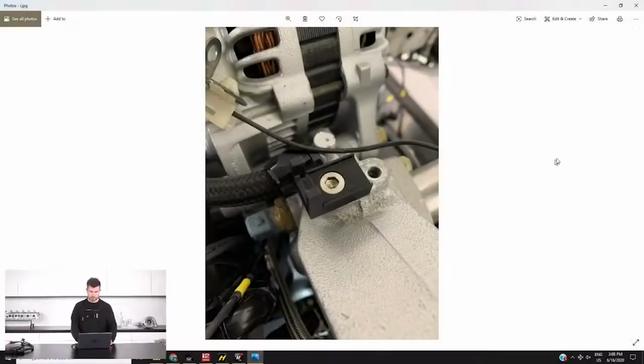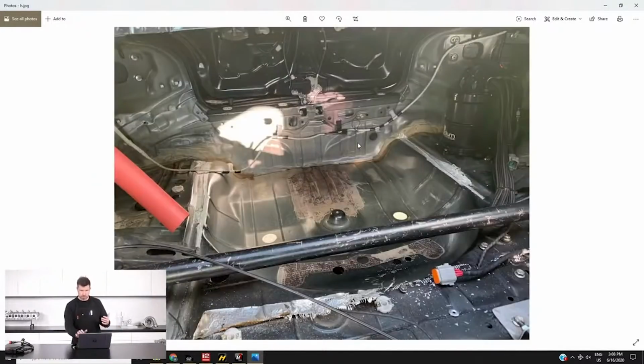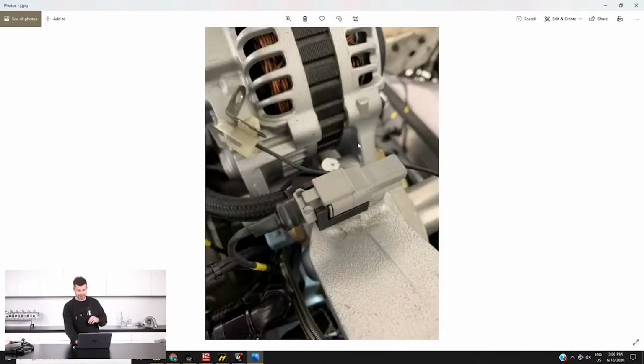We'll jump across to my laptop screen. Again, using the wonders of Fusion 360 and our 3D printer, Brandon printed up this little, essentially spring-loaded mount here for a 2-pin DTM connector. This particular one is for the fluid level sensor that goes into the header tank, or radiator top tank, if you like to call it that. Here we go. That's how it all sits there. So it's just a nice and neat way of supporting that little 2-pin DTM connector once it's all in the right spot. So a few other little finishing bits and pieces like that.